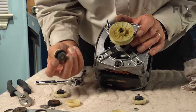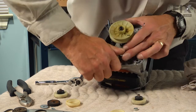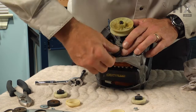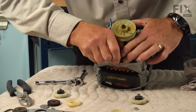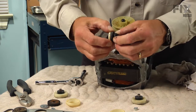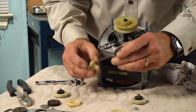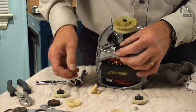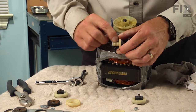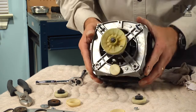Now with the new motor, start by putting in the slide. You may have to moisten the rubber portion to make it fit into the opening — just a little bit of dish soap is a good lubricant for that. It will go in easier if you remove the nylon slide first, then press the rubber mount in. You'll notice there is a bulbous shape to that glide — just force it in and that part is installed.